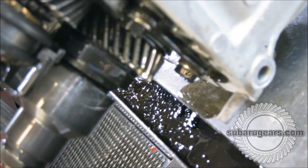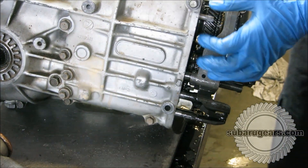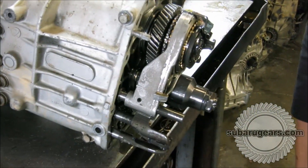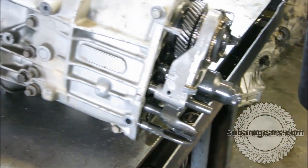So now we move to stripping the rest of the transmission. It's a fairly simple process — removing the horseshoe which holds the input shaft in its correct position, and then stripping all the through bolts from the transmission so we can break the case halves apart.